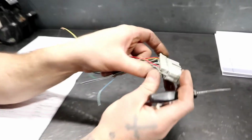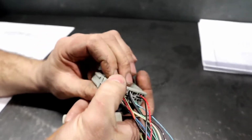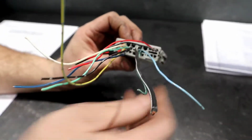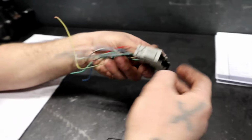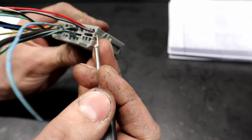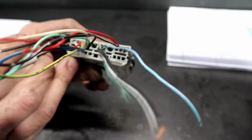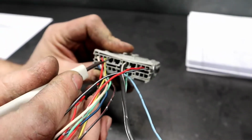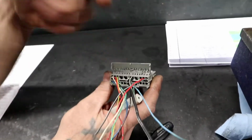All right, so now the C101 plug. This is how the plug looks once it's locked and closed, and the other side can go in. You unclip it. Now to open it up, there's a little section here that you can open up, that guy right there, and there's another one here on the side. Open that guy up. Once you have those two sides open, you just push it and it'll lift. All right, don't break it. Don't be like other butchers that I've seen out there that just break this guy off. Let it sit. It just needs to chill like that.